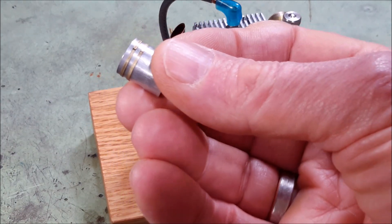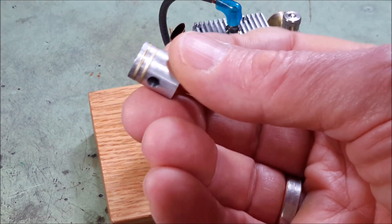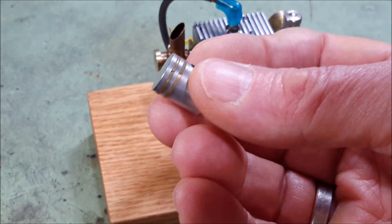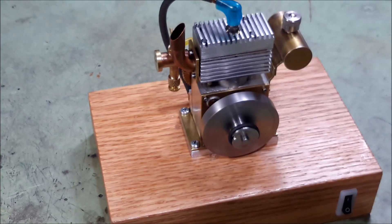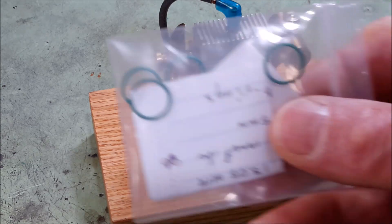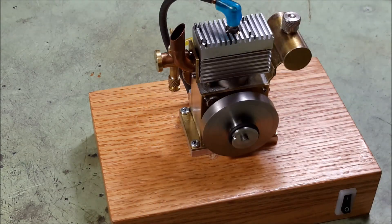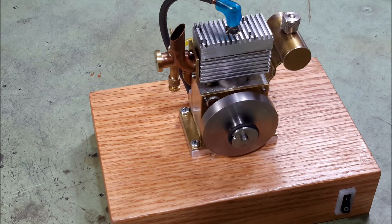In this case, the rings are made out of brass. My intention was that once I got the engine broken in, I would remake the rings out of cast iron, which is, to my understanding, the best material. But I ultimately went to using these little O-rings. They're made out of material that can withstand temperatures up to 400 degrees Fahrenheit, and as long as there's a little bit of oil on them, they should hold up pretty well. They make an incredible seal — there's almost no leakage whatsoever.